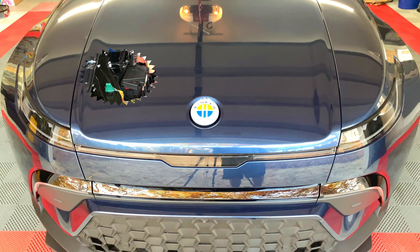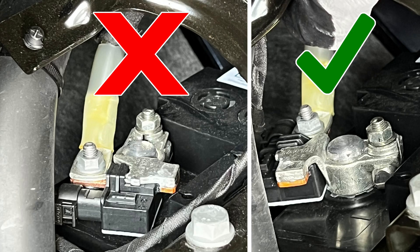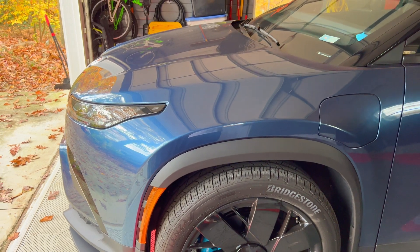This does not affect every Fisker Ocean. The 12-volt battery is disconnected for shipping — there is a plastic piece inserted so that the negative terminal is not connected. At arrival, when reconnected, some of the terminal leads are placed in the wrong position. This may cause problems with the 12-volt battery sensor. That's what we're going to fix today.